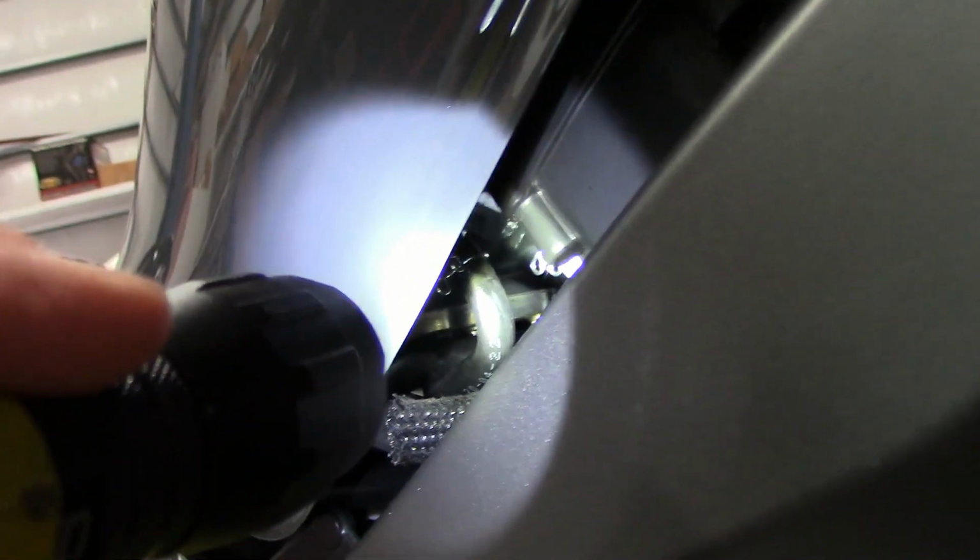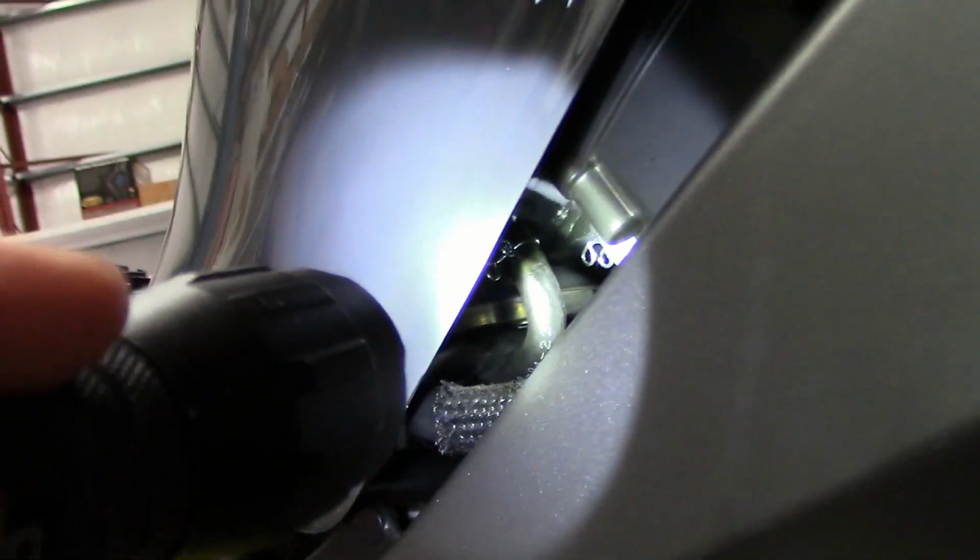But one thing I wanted to mention, and I don't know if I can do this by myself. Let me see if I can hang on to my camera mount wand, whatever you want to call it. Yeah, it's hard to see right there, but there, now you can see it. Can you see that? Okay, so this right hand recovery hose or breather hose off the bottom of the tank, the right hand one towards me, you want to put it between the main fuel line.